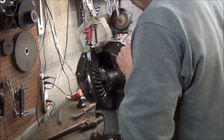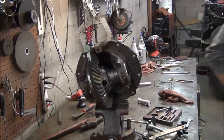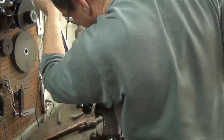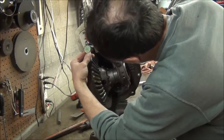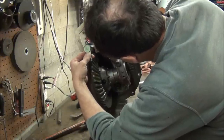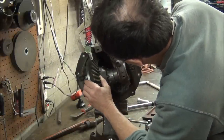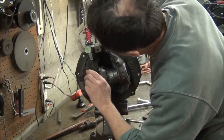And now, before I call it good, I need to torque these down. They're snugged down, but they're not torqued down, and I believe they're about 70 foot-pounds. See if that made a difference. What do we have? 4 or 5? Yeah. Make sure it's against it. Set that to 0. Grab the pinion again. You didn't change it. Four.